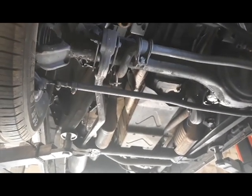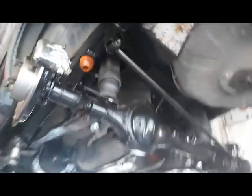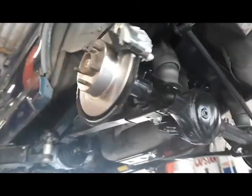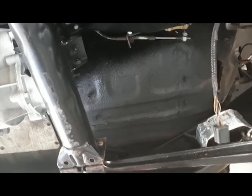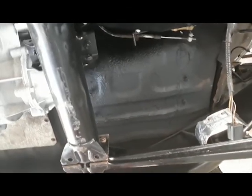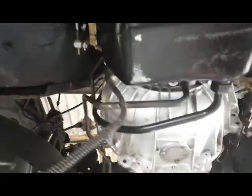Moving over to the next ramp — here we are with the Vogue 50th. I've just done a Facebook update on this with some pictures explaining what's been going on. A brief overview: rear axle is now installed, new airbags for the suspension, new brakes all round, new flexes, new bump stops, new height sensors. Underneath the vehicle the gearbox is now installed and we've repaired the floor — we've taken a panel out of a good P38 Range Rover and welded it into place by cutting the original floor out, making a really solid repair. New heat shields for the height sensors on the front. We're almost ready to start discussing the engine option with the customer — we'll reveal that soon.